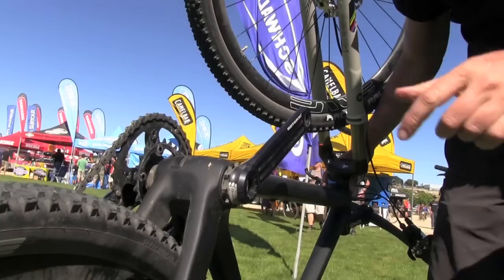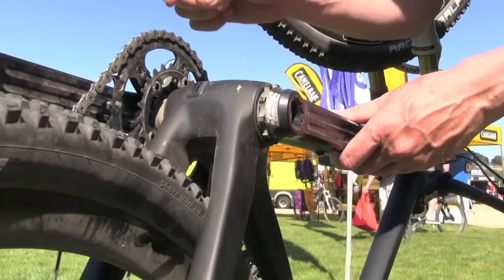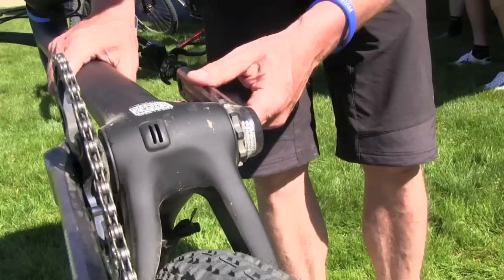What you have here is the BBright from Cervelo — an asymmetrical bottom bracket. Normally you're limited on the drive side with your Q factor; your pedal position has to be a certain way. Here you have your chainrings, but on the other side you have space that nobody uses. We use that space to get a wider bottom bracket, a wider down tube, and a wider chainstay. The chainstay is also asymmetrical, giving you a different and lighter combination.